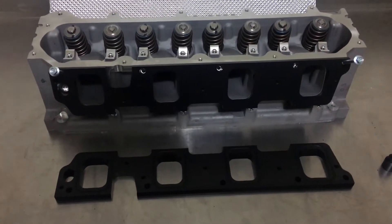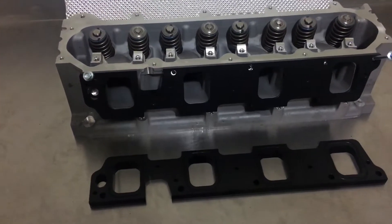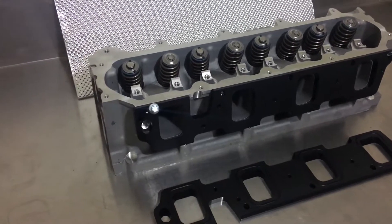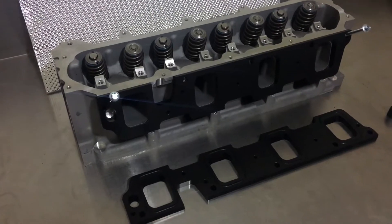This is going to isolate the supercharger from the cylinder heads and the motor. The charger will run colder, we'll have colder intake air temps, and the thermal blanket will reduce the absorption of valley plate heat into the charger, again lowering the temperature of the supercharger.